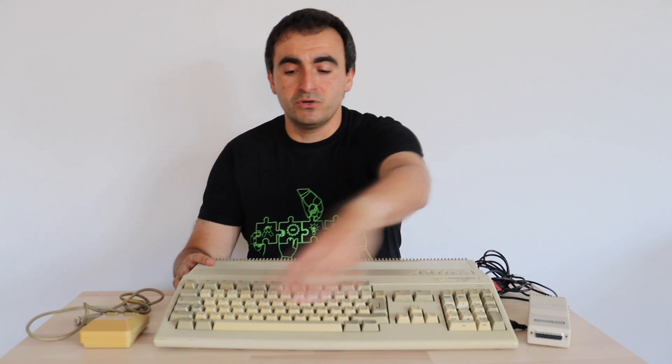As you can see, there is a built-in keyboard — it's a membrane keyboard, and 30 years later many of these keyboards require a repair. This is exactly the case with this Commodore Amiga. The keyboard was broken, some of the keys were not working, therefore I had to replace the membrane with a printed circuit board. Let me show you how I did it.